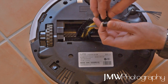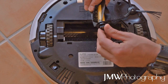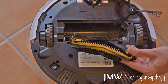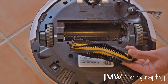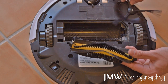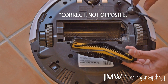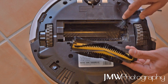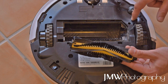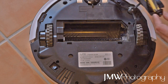It's actually not that hard to clean - it's a case of pulling hair off. This part ends up getting extremely clumped up, which causes it to seize up completely when it should spin smoothly. That's what was tricking the robot - everything else wasn't spinning smoothly. Before you clean, make sure everything does spin and move without resistance. Certain things like this are attached to a motor, so spin it in the opposite direction the motor spins - you'll feel magnet resistance but it shouldn't actually feel seized.